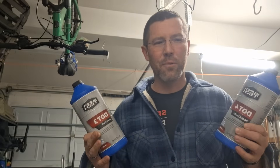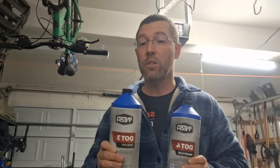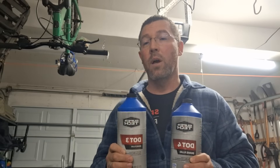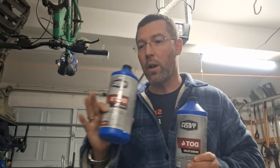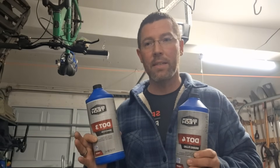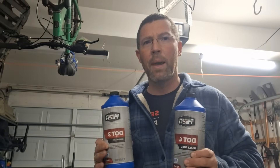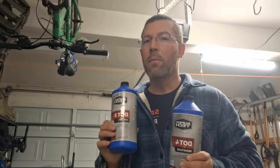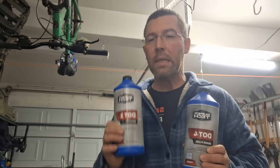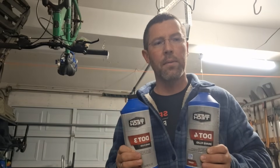One critical thing to know: brake fluid is really, really bad for paint. Leave it on the hood of your car overnight and you can almost wipe the paint off. I actually used this on a motorcycle I bought — I poured brake fluid on the gas tank to remove old paint from the 70s. I wiped it on, let it sit for a couple hours, and rubbed the old paint right off. So if you spill brake fluid on any paint, wipe it up quickly with Dawn dish soap, a little water, and follow up with wet rags.